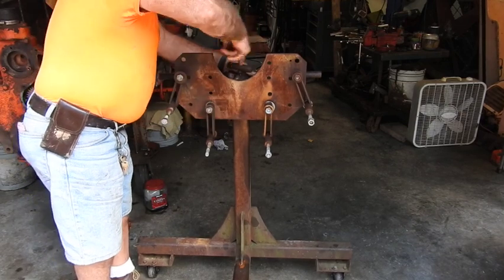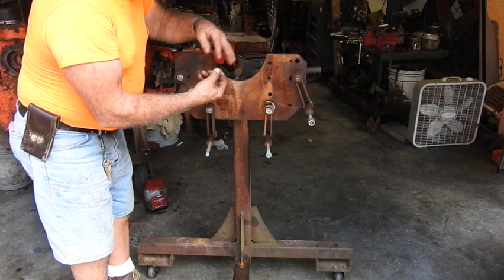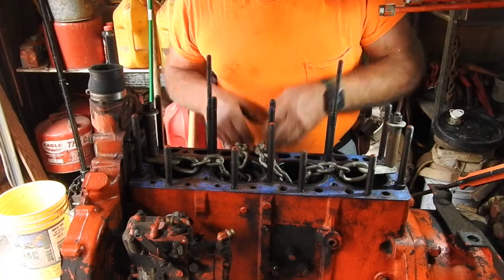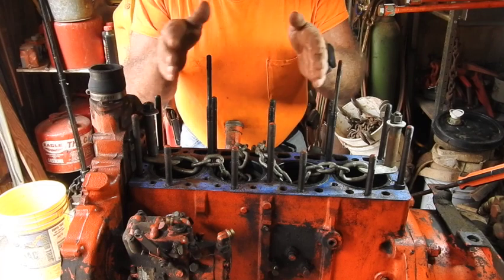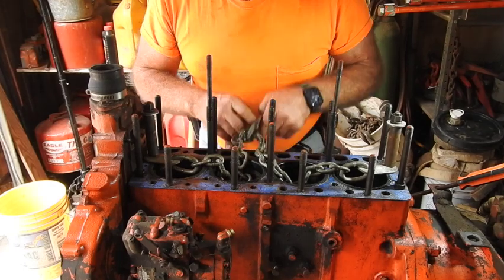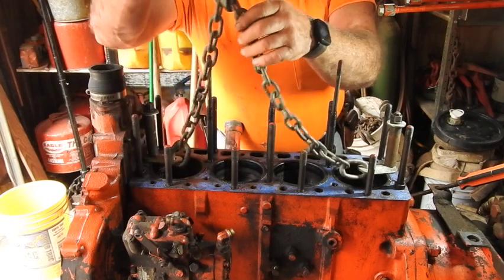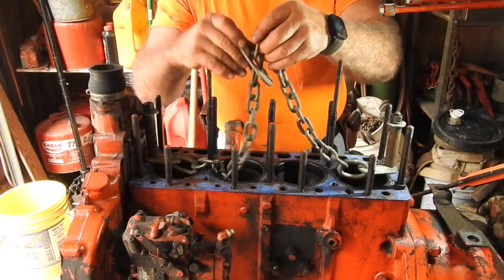Or rotate it back around to the top. Each position you stop it in, you just run the T-handle in and it'll run a set screw — a big bolt that I ground into a set screw — into the dimple and hold it in that position. When it comes to actually disconnecting the engine from the torque tube, you want to have either an engine leveler, which has a crank on the end that by rotating shifts the weight or balance of the engine one way or the other for the lifting eye. Or you can just use a simple chain setup like this right here, which has a T-slot for the chain links so you can adjust it from here or a different link back there to level out the weight of the engine.